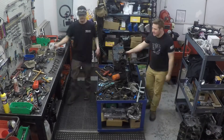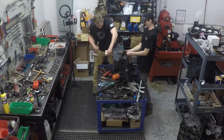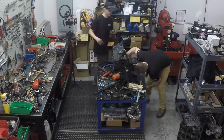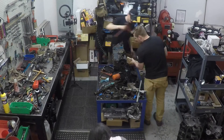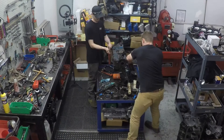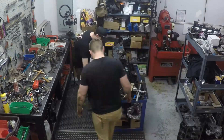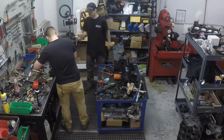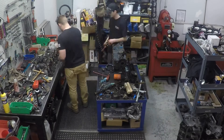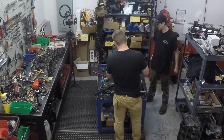After that we set out popping out the pistons using a hand sledge, rubber mallet, and a block of wood. They were a bit of a challenge because, as you know, this engine was seized — so they were in there pretty tight. After a little bit of effort and patience we did manage to get all six pistons out, making sure to keep all six pistons and their associated rods in the same order. Fortunately, all the rod caps, piston rods, and main caps are stamped or marked in their particular order, so putting this motor back together should be relatively straightforward.